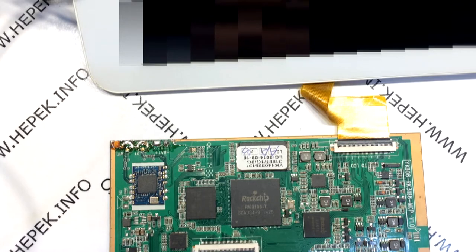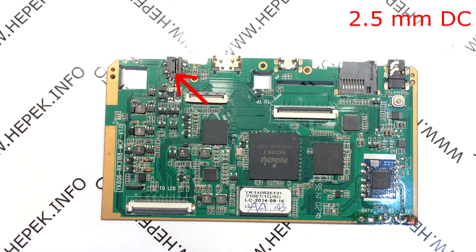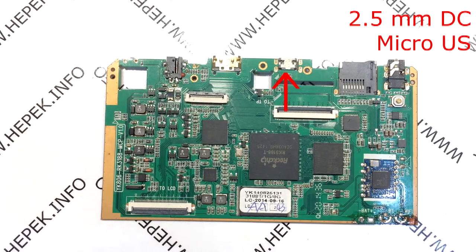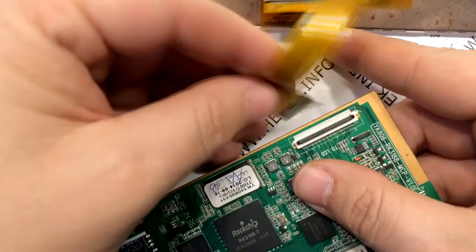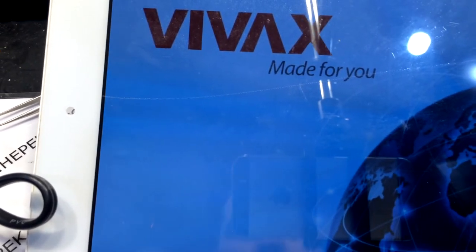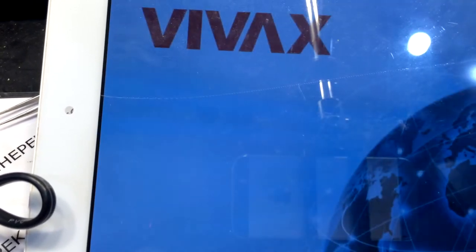Now, how do I think to solve the power supply? This tablet has 3 power connectors: one is a classic 2.5mm DC connector for the original charger, the other is a USB port that also supports charging, and the third is the battery connector. The first step is to check if this tablet can function when connected to the charger only, without the battery. I connect the display to the motherboard and connect the USB charger. It shows charging even though the battery is not connected, which is a good sign — so it doesn't need a battery to function. When I turn it on it starts to light up, but after a short time it stops, which makes me assume there isn't enough power to run it properly.